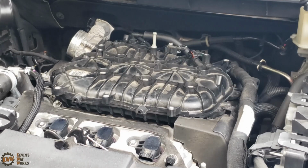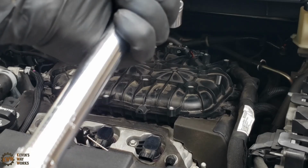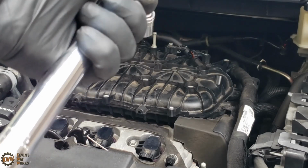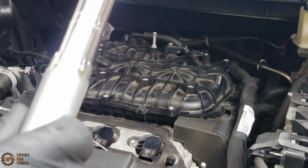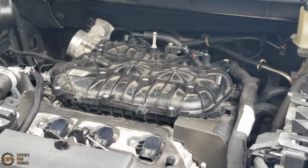All right, there is a tightening order. It says tighten in sequence to 18 foot-pounds, then tighten again in the same sequence to 18 foot-pounds. So we are on nothing. 5, 10, 15. You're not even seeing this. I'm sorry, guys. I'm horrible with the camera. 18 foot-pounds. Not inch-pounds, foot-pounds. Gotta be careful. I've seen people torque 80 inch-pounds to 80 foot-pounds and just destroy things.